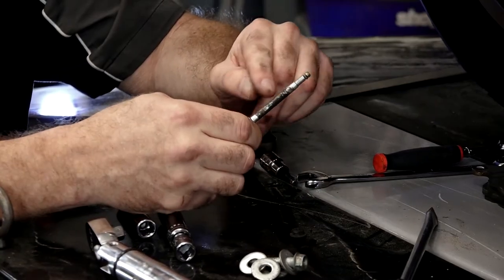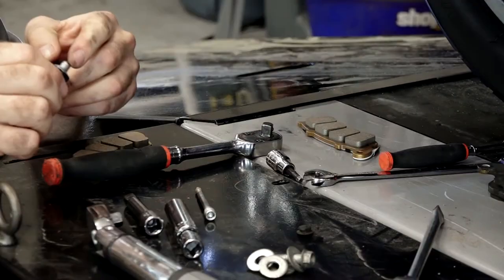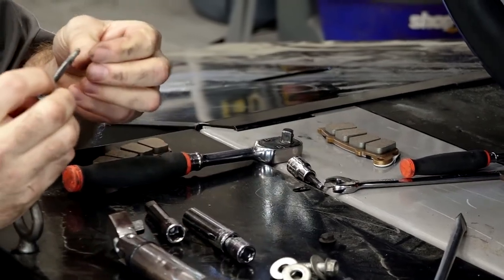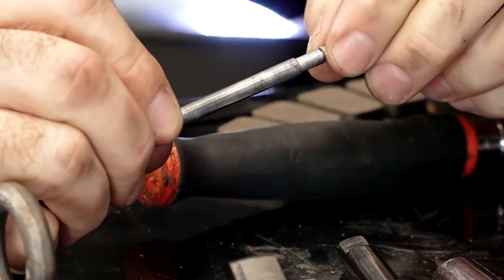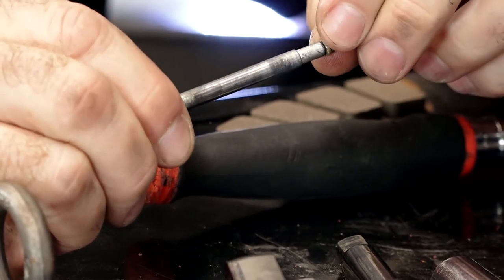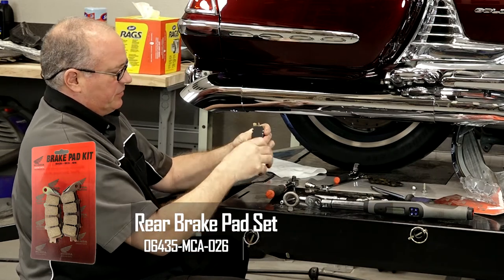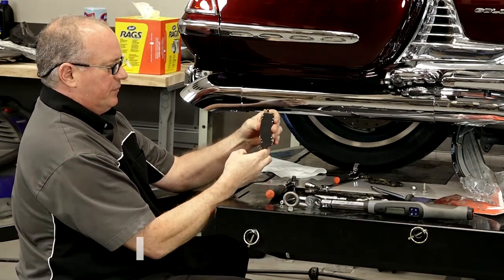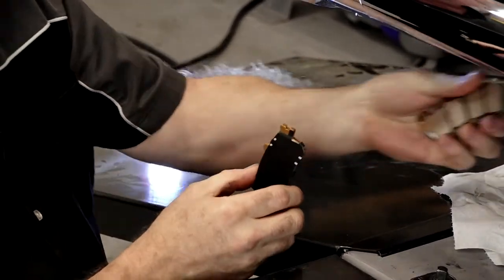What I want to do now is clean up this pin, and when we go to reinstall it, I want to put a little bit of grease just around this little O-ring — not on the entire pin, just on the tip — which makes it easier to insert when we reinstall. Then we'll get the new pads put in. We're going to feed them up and get these upper edges into that upper shelf. You'll feel them click in, then hold it up and push the pin all the way through the caliper and through those points.